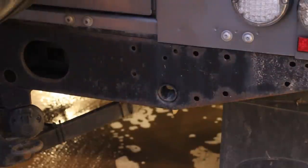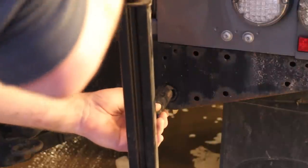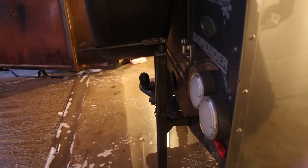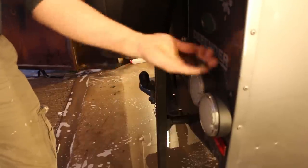If you have one of the older style Land Rover jacks, wind the jacking tube to the height of your jacking holes in the crossmember or dummy iron. Slide it in until the lug is flush with the surface of the crossmember and it can go in no further. Ensure the jack is vertical and perpendicular to the ground, then using the ratchet handle wind the Landy up. This will take a while — the jack first has to take up the suspension travel as it's lifting the body and chassis first.